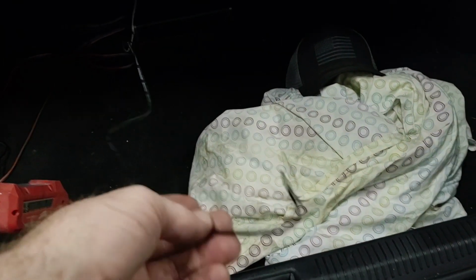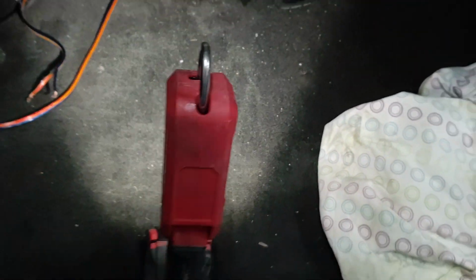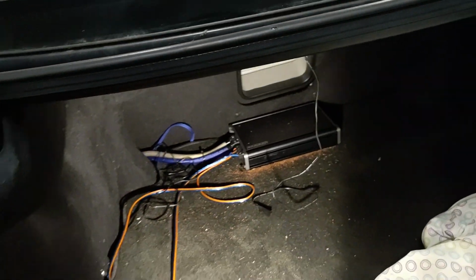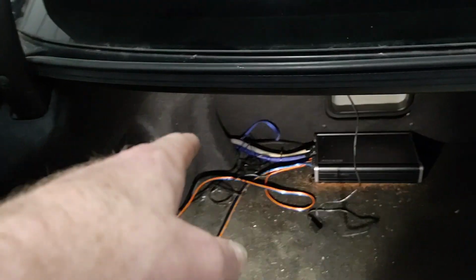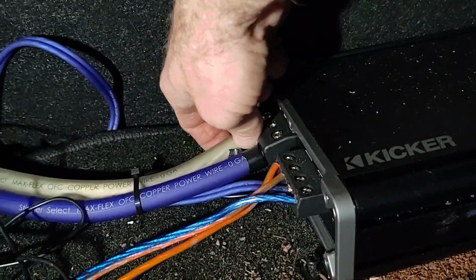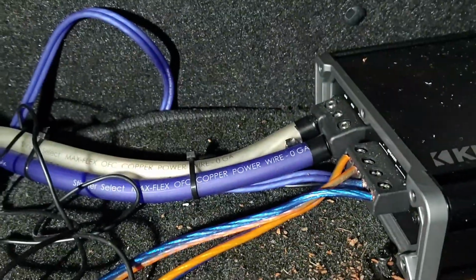I got these wires from the trunk extended from the light there. That's gonna be our LED control there. And what else? I had to redo this ground wire. It's hard to see, but I mean, I've just been redoing all the wiring anyway, but I did keep a couple of the pieces in there just because it is good wiring, nothing wrong with it. It's just some of the ends aren't good. So redid the end on that ground. And then here where they're going into the amp, as I expected, somebody just skinned down a bunch of the wire. Let's see. There's no reducers, no ends on these. So somebody just skinned down a bunch of the wire, shoved it in there. So I got those reducers. We'll redo this when we hook the amp back up.